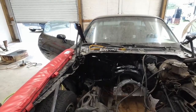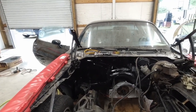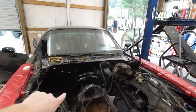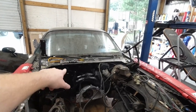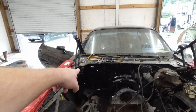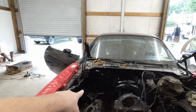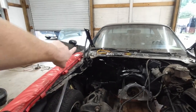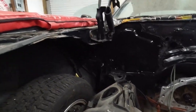All right, plate's on. A couple of the bolt holes didn't jive with what was already on the firewall. I got to make a couple new bolt holes, and I got to put 2 nuts behind those 2 bolts, the far right bolts. No big deal. That upper one up there doesn't go to anything, but I can drill it and put a nut and a bolt. The 2 on the heater core side, probably not going to be able to see it because it's too dark.